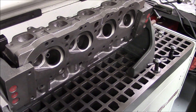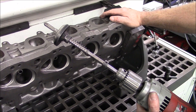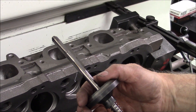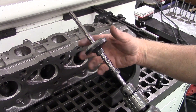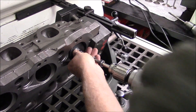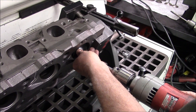This is super important that this gets done accurately as possible. After we've reamed our four new guides to get them somewhat straight, we're going to core drill them with this core drill — it's a carbide-tipped core drill. It's very important that this hole gets straight and round without any deflection. I put a tremendous amount of pressure on this collar. I like to get it at an angle where I can really get a lot of pressure on this collar so the drill can't move.